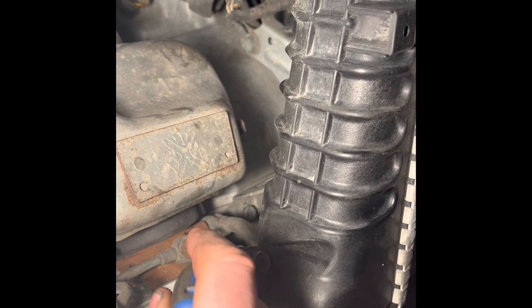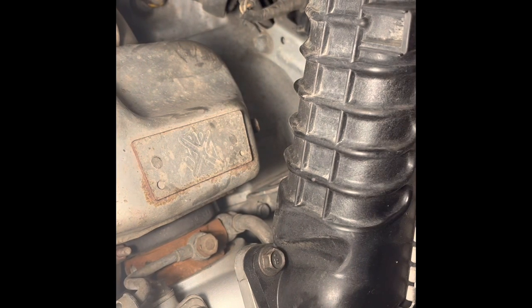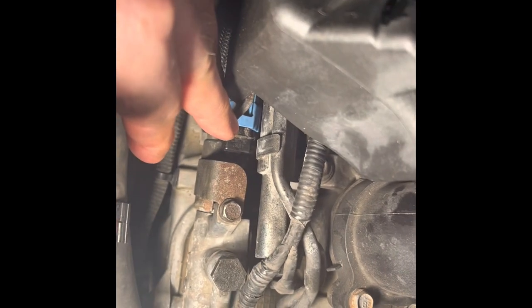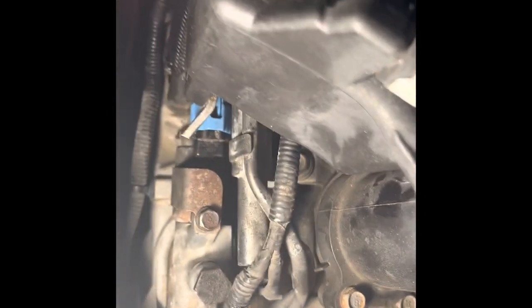To access the one at the back, I'm probably going to have to pull the intercooler off, or I may be able to get in from around the back. The car's been parked for quite a while so the turbo is cold, but if you're doing it just make sure you don't get burned. I did switch the actuators over and also used some dielectric grease in the couplings to ensure good contact. I checked the wires — they don't seem like they've been pulled out or anything.